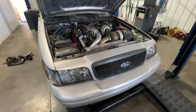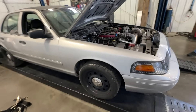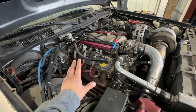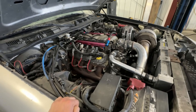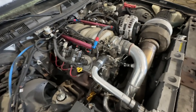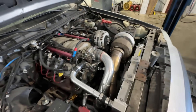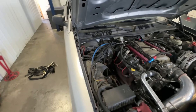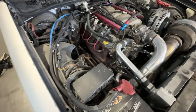For those of you who haven't seen any videos on this thing, here's a quick overview. It's a 2006 Ford Crown Victoria with a 4.8-liter in it. It's got Gen 4 rods and pistons, stock heads, Brian Tooley LS9-style head gaskets, stock bolts, FAST intake, Bosch 210 injectors, VS7875 Gen 3 turbo with a 1.25 exhaust housing. For fuel we're running E85 — it's set up for flex with two 450 fuel pumps in the back.